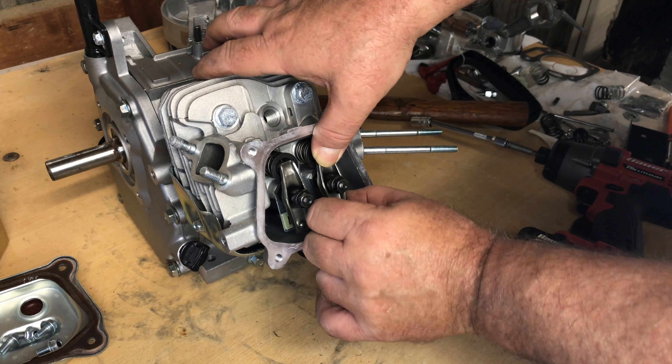I was a little worried about balance because when I change the piston to a 70 millimeter unit you're going to be adding some weight. This engine has corroded head bolts just like the other one. I don't know if that white stuff is some kind of sealer they put on there but it didn't do a very good job — it seems acidic and crusted up the bolts. It's got another thin head gasket and the same thick heavy duty push rods, which is good.